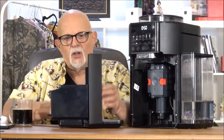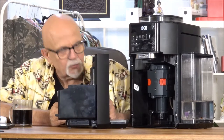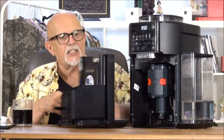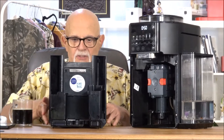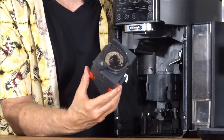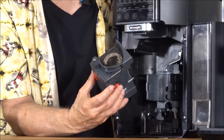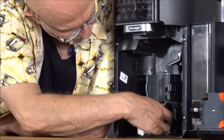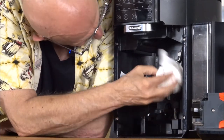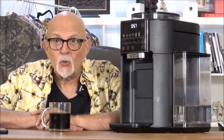There is the cleaning. You have to dump a couple of reservoirs. This one has actual fluid in it — it's a reservoir for the water that the machine cleans itself with. This is the used grounds, so you have to clean and wash that up. It doesn't let you get away with making more than 8 or 10 cups of coffee before you have to do this maintenance. Whenever you take this tray out, I highly recommend pulling out this mechanism — it actually makes the coffee, and it sometimes gets a little coffee left over that needs to be rinsed off. There are also some coffee grounds that get down in here that need to be wiped out. It's not really a pain, but it needs to be done every now and then.